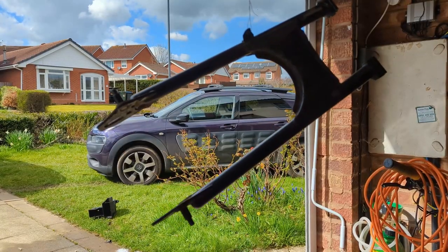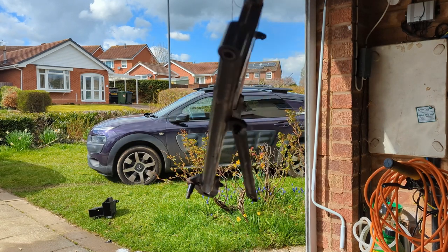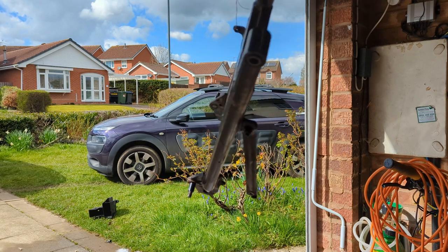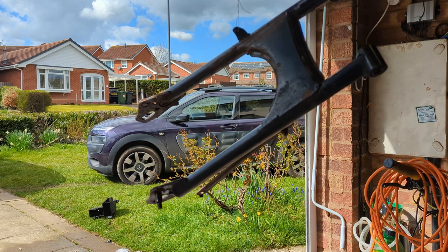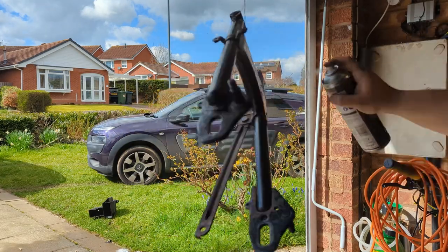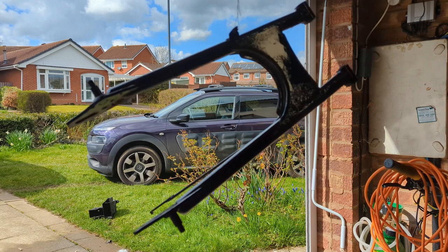Just giving the swing arm the same scrub-down treatment and we'll check out the bushes. It's been degreased, wire brushed, degreased again - all the flaky crap's off, all the muck is off - so time to spray it with garden fence paint. As I said before, I know I'm probably going to catch hell for this. It's not a show bike, I just need to stop it rusting anymore. If you want one of these, go buy one and do it up properly, get it all powder coated - but it's going to cost you significantly more than a grand. I think that'll do; drips and runs are fine as long as they're not onto my garage floor.